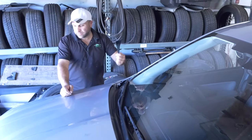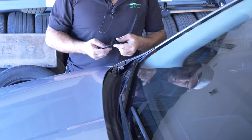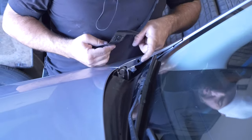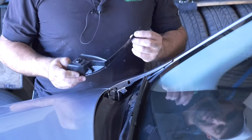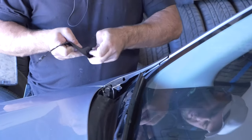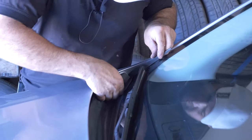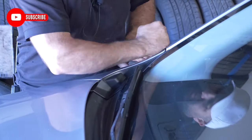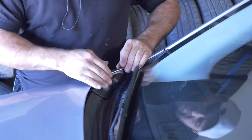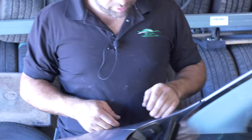So we're going to go ahead and put this on. Usually I open the hood — these two guys need to go into here and there's one hole right here that holds this clip. This is the one I break all the time, and then this thing slides underneath the fender. Put these guys in first; this is the hardest one — there he goes. And that's it really — that went on really easy. I've always had trouble putting this on.